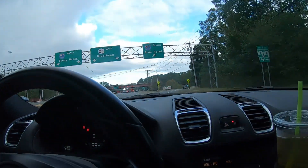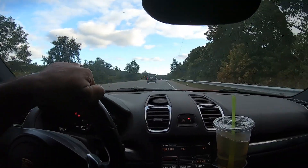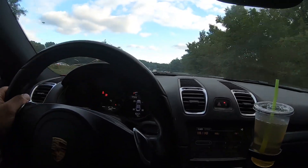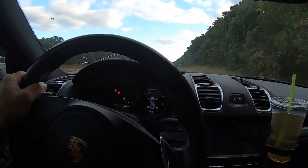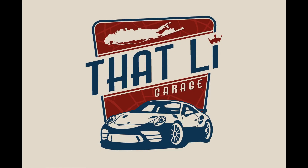On the power steering, that light went out. I had to turn the wheel all the way to the right, all the way to the left, to have it relearn. Before I wasn't able to do it because the alignment was so off that it wouldn't let me go all the way to the ends. Feels nice, very smooth. You ain't got haters, you ain't poppin'.